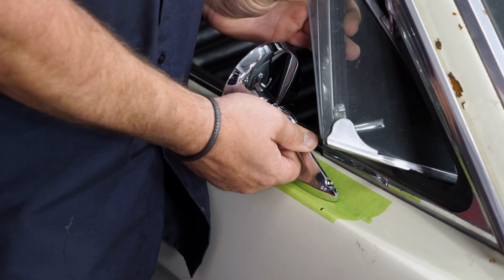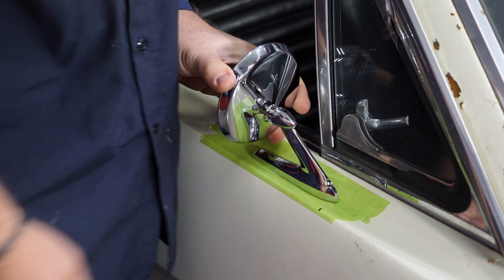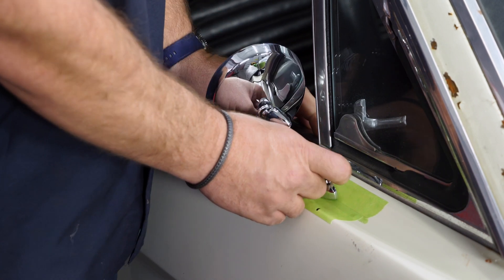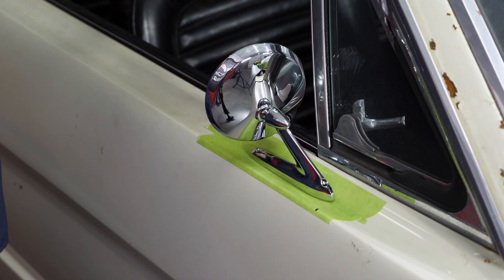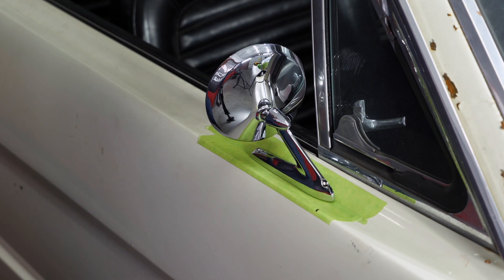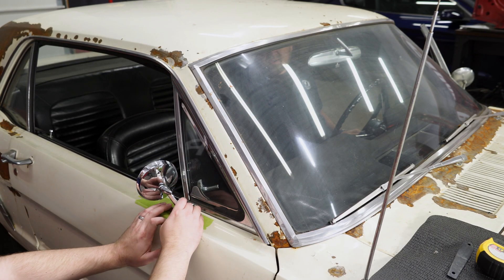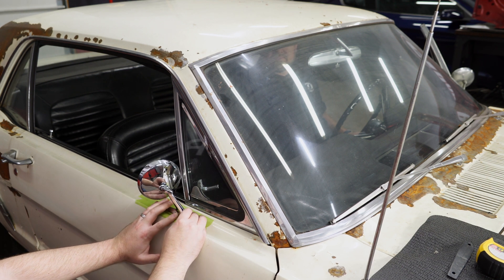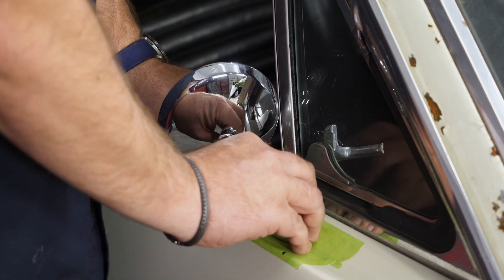Make sure you don't have any clearance issues with the vent window. It's not a bad idea to have an extra pair of hands to hold the mirror, but you can actually let it sit there — it shouldn't go anywhere. Jump in the driver's side and make sure the mirror is actually working. It's a tiny mirror, so you're not going to see as much as a modern mirror, but just make sure you can get a line of sight where it's functional. Actually hold the mirror and tilt it in slightly. Now we checked — it is tight up against everything, but it's exactly where we want it, so it is functional.